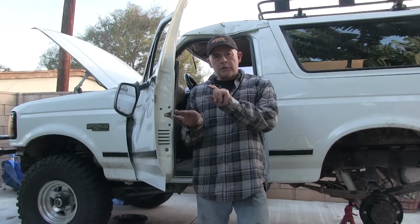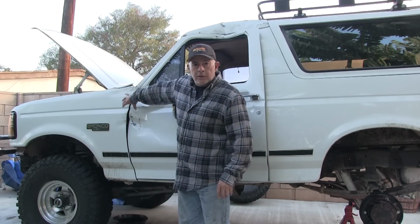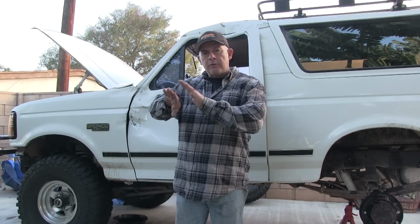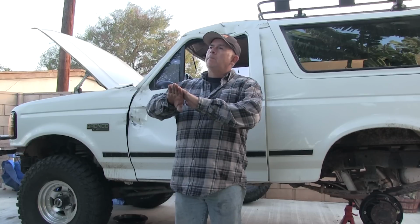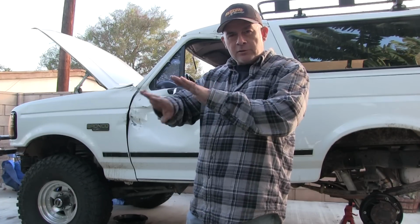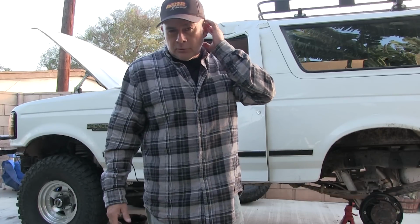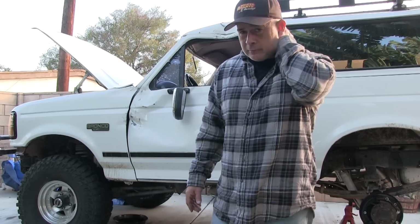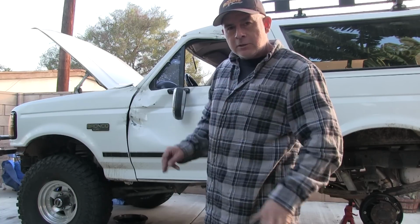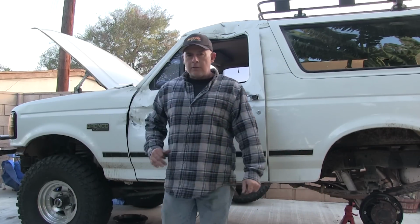The brake pedal has a little switch on there, and apparently since this got pushed in, the switch and the thing that actuates it are now too close together. Anyway, when you push the brake pedal, the switch actuates and the light goes off on the brakes. They've been stuck on since I rolled it over, so all I did was pull the fuse on it. I thought it was something more serious, but I think it's just a little adjustment in that switch will fix it. Bend something. So that takes care of the brake problem.